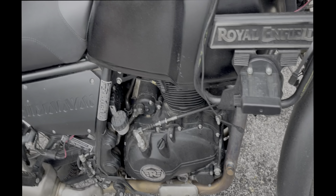So very similar. Torque curve, I guess for a 465 cc, somewhat flat. It's a single cylinder, you're always going to have more torque at lower RPM. It almost looks like a diesel compared to that. You got a lot of torque here, and then it really drops. But there's just a fat ton of torque right here, and you're not even moving much in the low.